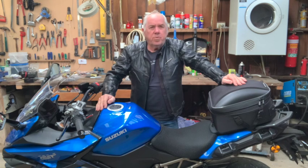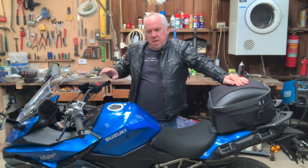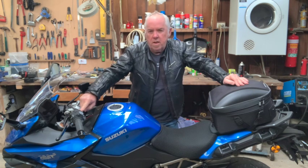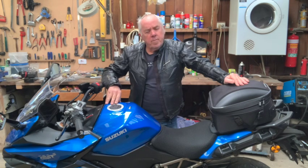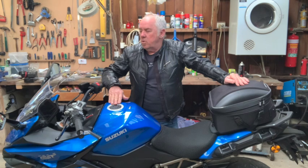After that test ride, I'm much happier with the riding position — especially combining the seat sculpting from the last video with these handlebars. I came back and adjusted them down just a fraction and also drilled out the locating hole for the pin on the switch block slightly bigger so I could twist it down just a fraction — the blinker switch was just a bit too high. It all feels really good now, so very happy with my decisions. Thanks for watching — if you liked this video, give me a thumbs up, subscribe if you like the series, and let your mates know especially if they've got a GT. We'll see how she goes down to Phillip Island and back.